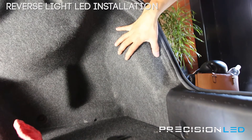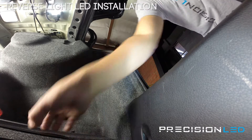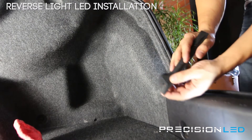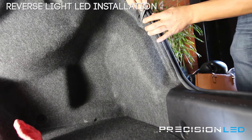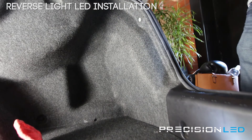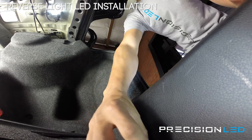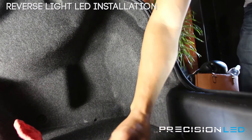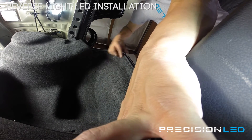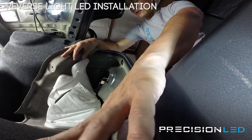We're looking here at the interior of the trunk where the backup reverse light can be accessed. We're going to take off this clip here and this clip here at the bottom and flip this panel up so you can push the interior liner all the way back to access. We'll use one of our tools, coming from the side, separating the black piece from the clear plastic piece here. It comes out pretty nicely. Moving this clip on the bottom, we're going to flip this panel up, and that allows us to pull the liner all the way back and gain access to the bulb.